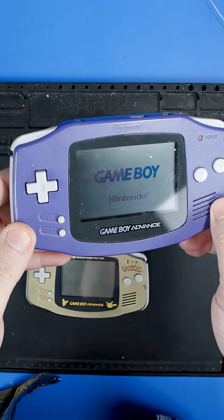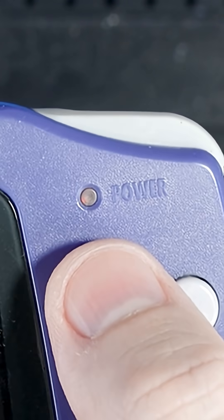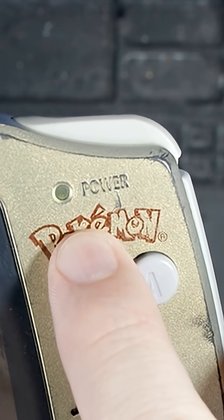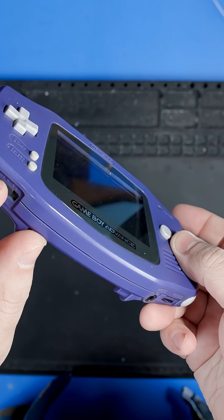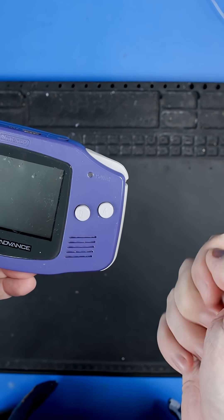I did a short a little while ago featuring this purple Game Boy Advance, and a lot of comments said I really need to change my batteries because the power light is blinking red. Well, here's the thing — if you notice, those batteries are just fine. The issue is actually going to be with the power switch. When those get dirty, it causes poor contact, which makes it harder for it to turn on and off, and actually causes the power light to blink red.